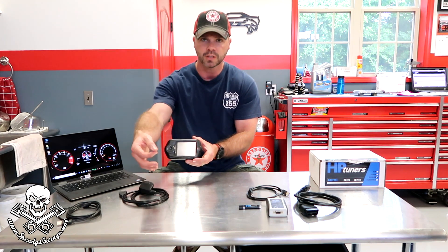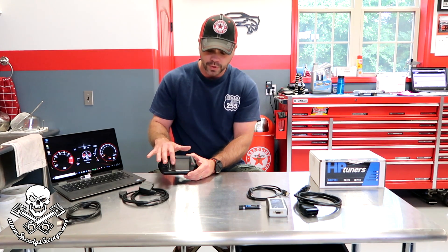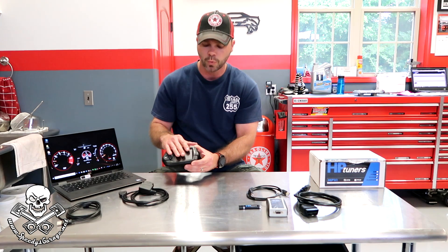You can data log the factory PCM no trouble because it is just pulling data that goes across the CAN bus and these tools will do that no problem. However, as I was building the dashboards and adding the PIDs that I wanted to get metrics on, this thing would lock up occasionally — actually a lot — and I would get four pages into what I wanted to build as a dashboard and have to start all over again. You have to have the car running to build the dashboards, and I'm sitting out here with the car idling for a half hour trying to get all the dashboard pages built. Kind of a pain.